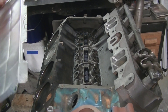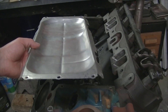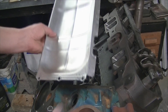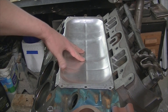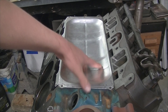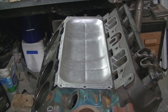How this is going to get installed — this will get installed before the cylinder heads get put in place. The downfall of this setup is that it can only go on with one of the cylinder heads off. You can get it in here with one cylinder head mounted, tuck it in underneath there, and it fits pretty good. I had to trim this down just to fit inside that rail, trimmed it really nice and snug. One cylinder head has to be off in order for this to be installed. Going forward, if we ever had to take this off in the car, you could sacrifice this, bend it all to hell and get it out if need be, and go with the Hughes two-piece design.